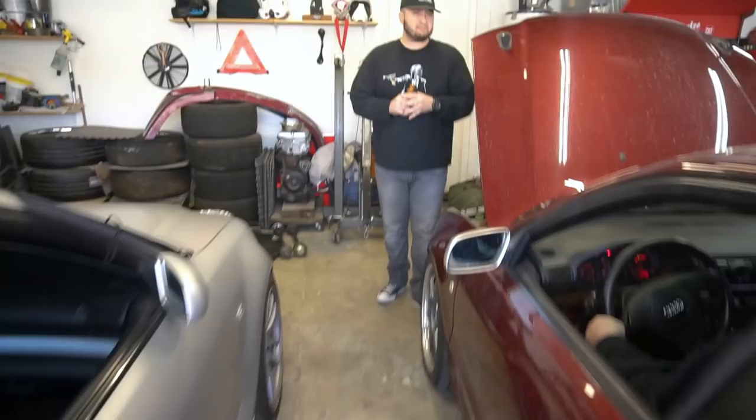So it's a little lumpy. Stav is running an aftermarket cam, plus it's got 2150 cc injectors. He's running a single in-tank pump right now. Should be able to make the same power that I did, however he may make more, being that he's starting off with a much larger injector than I did.